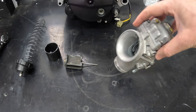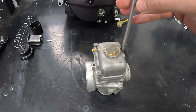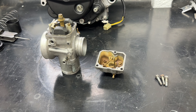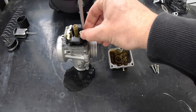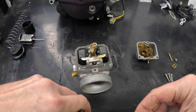Everything looked pretty good in there — I was happy to put the cases back on. On the generator side it was 5 Newton meters, and on the clutch case side it was 10 Newton meters. These are not original bolts — undecided where we're going to keep them — but they are stainless and they held the torque fine. With gaskets in place it was then time to have a quick look at the carb, and when I say quick look, it wasn't what I was expecting inside.